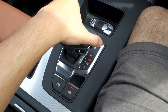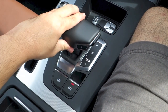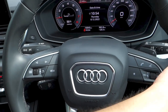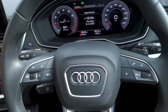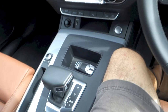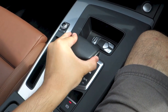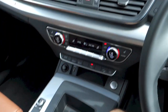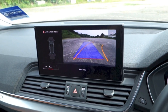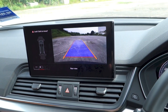In Malaysia, the 2.0 TFSI 249 engine is paired to a 7-speed S tronic dual-clutch automated manual transmission. Two clutches are used in an S tronic transmission, one for odd gears and another for even gears. S tronic is designed to give drivers faster shift times and better fuel consumption over a conventional automatic transmission. This transmission features a sport mode and tiptronic manual shifting, the latter controlled by either the gear lever or the paddle shifters behind the top two steering wheel spokes.